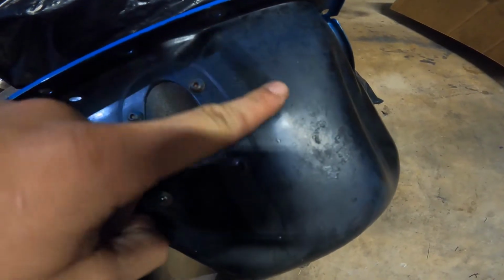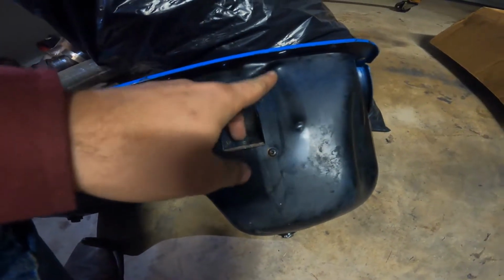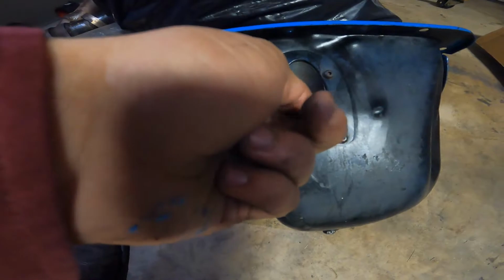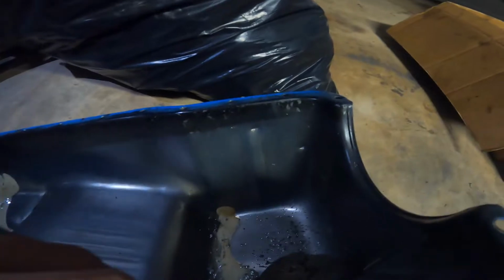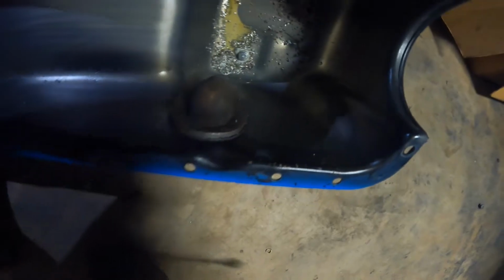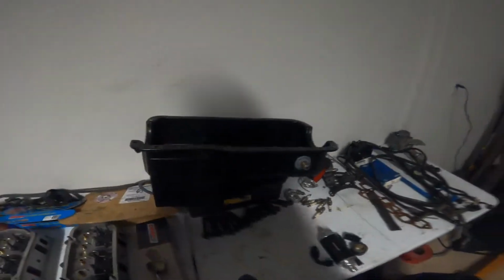It got hit by pieces of piston that fell and got between the crank and the oil pan, and not really a huge deal, except it pushed it out right here, and it was leaking where the dipstick thing is. And instead of trying to beat that back flat and use an RTV, I beat up the oil pan pretty good. It got it on the other side too. You can see the witness marks. I'm just replacing it. It was only a 5-quart oil pan anyways. I went with a 7-quart replacement.